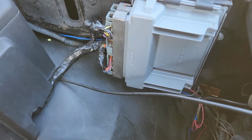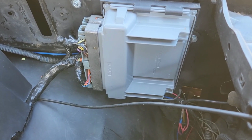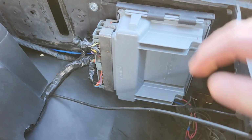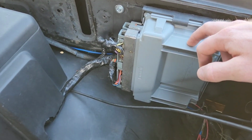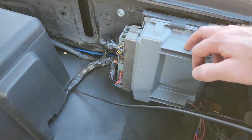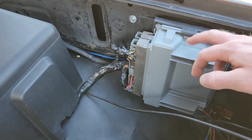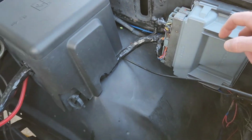And an eBay PCM. I did not buy HP Tuners or anything. Bought this pre-tuned 6.0 4L80. Power enrichment turns on at 75%. Torque management's turned off, so she feeds her all the onions as soon as you get into it and doesn't back out. It works great. I've had zero issues, but I've started doing my own tuning now. I'll call it tuning, you know, universal patch and LS Droid. So I'm going to be playing with a few different ones.